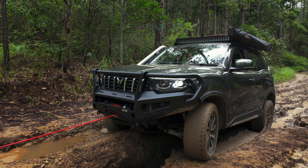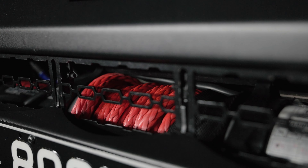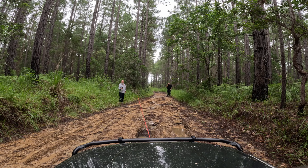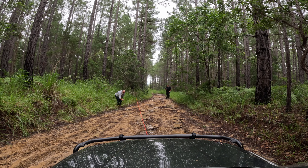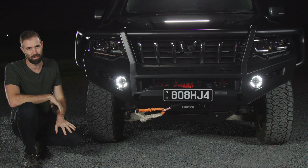It also accommodates a 13,000-pound winch — this is the Runva — and it's actually helped me once or twice before and did the job perfectly. I chose a 13,000-pound because you don't want to max out your winch. A lot of the time when people are doing long pulls, they can burn out easily, so 13,000 pounds for this size vehicle is the perfect size.